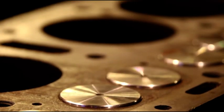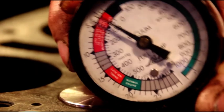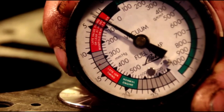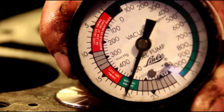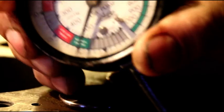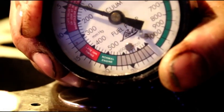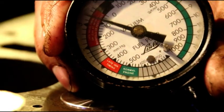We've got the vacuum pump on and we're going to check these valves. We're pulling 20 inches of vacuum on that exhaust valve. No trick photography or anything — no spring on that valve. We just have a three-angle valve job, and that's pulling 20 inches.